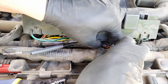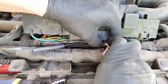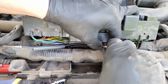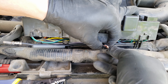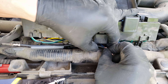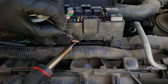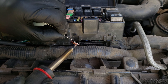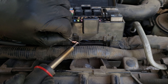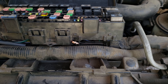At this point, wrap the black longer wire strands around the shorter wire, trying to make it look as clean as possible while making sure it has good contact. Now using a soldering iron and some 60/40 solder — once the soldering iron is hot enough, place it under the wire strands and slowly feed the solder into the wire strands. The heat will draw it through so it bonds the wires together. You'll want to avoid coming in contact with the harness underneath and avoid contacting the distribution block.